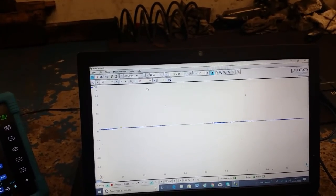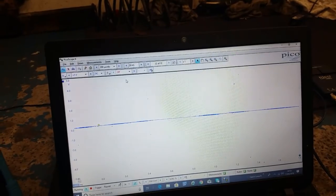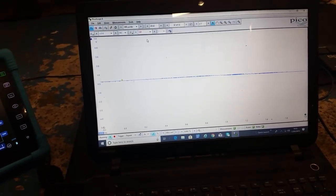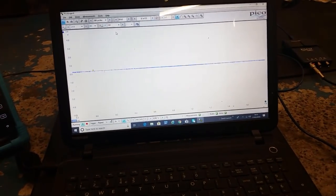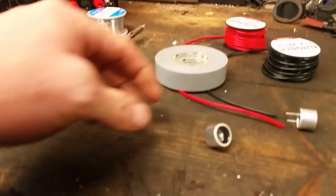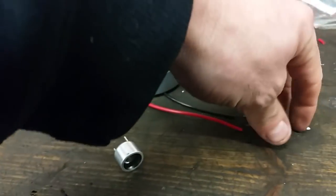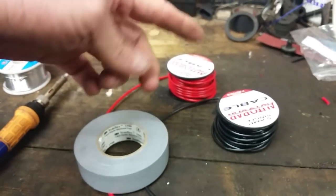That's the best I've been able to get it on the Pico — close to the same settings as the MicSig, but I've had to up the scale because the lower scale just goes mad. The Pico 2000 series just hasn't got the speed to pick that up cleanly. This thing costs 80p to make — well, £1.60, and you throw one away. Here's what you get.